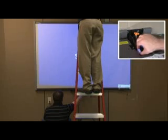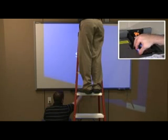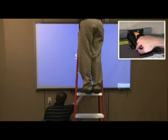The purple knob impacts the yaw, or angle, of the projector, impacting the image shape and horizontal position. It will also slightly impact the tilt of the projected image, which is primarily controlled with the blue knob.